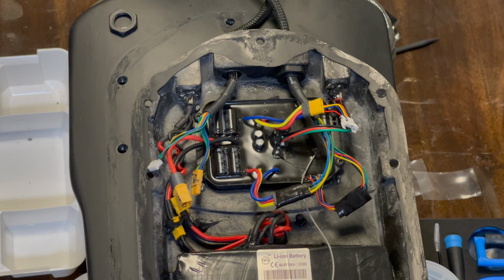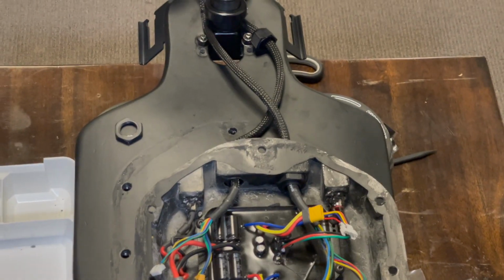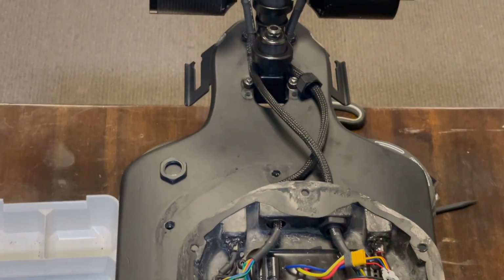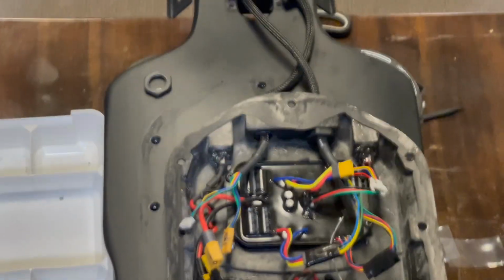So generally what I do is, if I'm taking it apart, take a photo of the way round that it is when you took it apart, and then make sure that the left and right go together. Speaking of left and right as well, make sure that when you're plugging them in, because the battery enclosure is upside down, you've crossed the wires over when you're feeding them through the little holes there at the back of the enclosure.